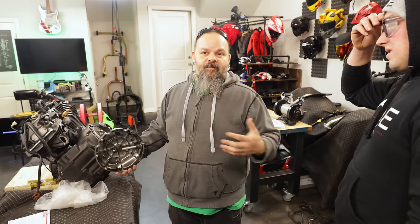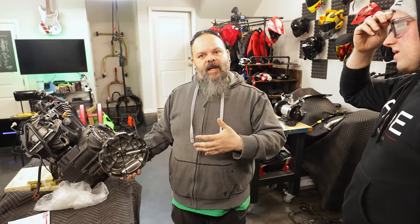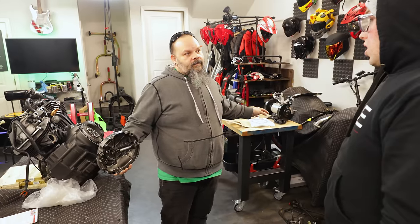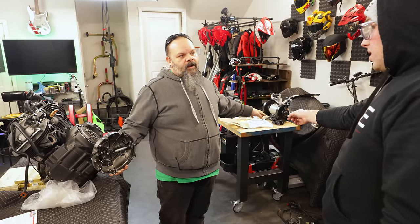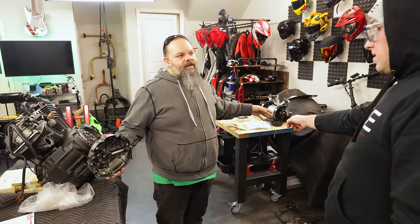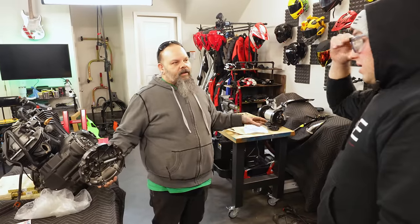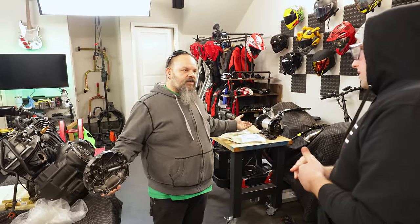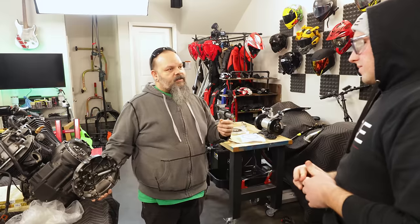When you drain the oil or you pull this cover off and you smell campfire, you're in trouble. That means that your clutch plates have been burned. And the reason why it smells like campfire is because your clutch plates are actually made out of cork. Those things are made out of cork? Out of cork. Like what you put in a wine bottle? I mean, a different version of it, but yes, cork. It's processed and it's mixed with other things, but predominantly that clutch friction material is cork. It's just very dense.